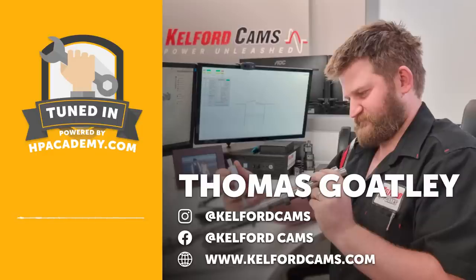Kelford has a good team with technical knowledge to help customers, and a good online form where you can submit all your data and they can help pick a suitable camshaft — or tell you that what you're asking is physically not possible. Ideally when designing something, the camshaft is the last bit of the equation. You work out the limiting factors — things like single overhead cam stuff not being able to handle high-RPM stresses with a big fat rocker arm — and then design the cam to best suit that setup.